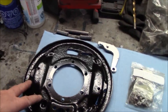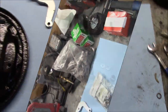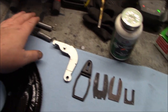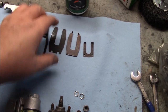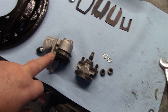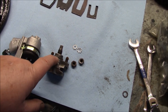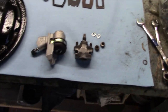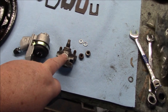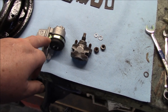We're going to start working on the brake back plates - put the wheel cylinders and adjusters in. Here's the brake backing plate, the lever for the emergency brake, the springs for the shoes, and the wheel cylinder fixing kit with three locking plates and a little boot. There's the new wheel cylinder. We're using the existing adjuster - we just cleaned it up - because the new adjusters tend to break off the studs at the rear. We'll lube it up, find some new nuts, and we've got new lock washers. We'll install the brake shoe adjuster first, then the wheel cylinder.